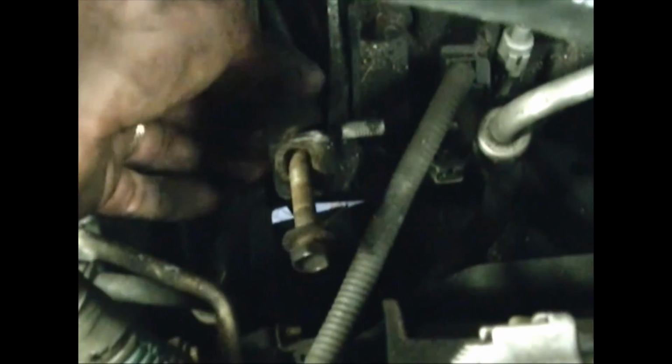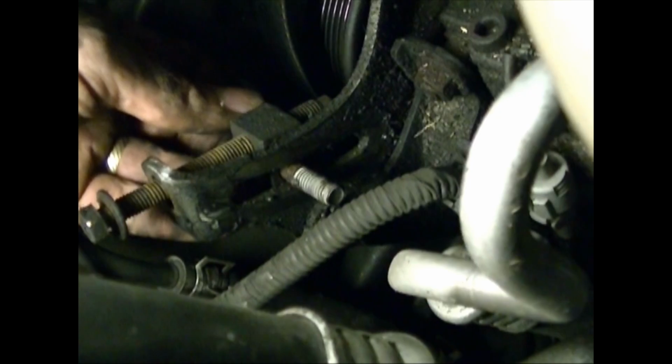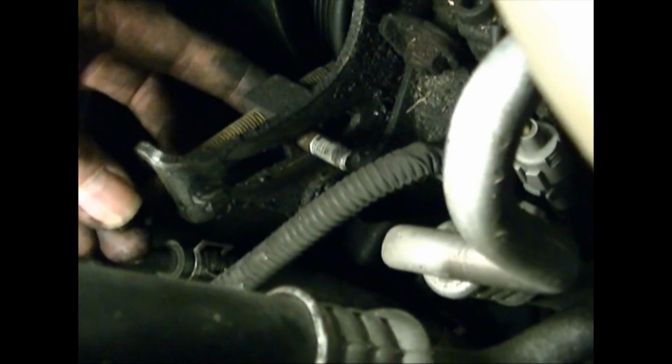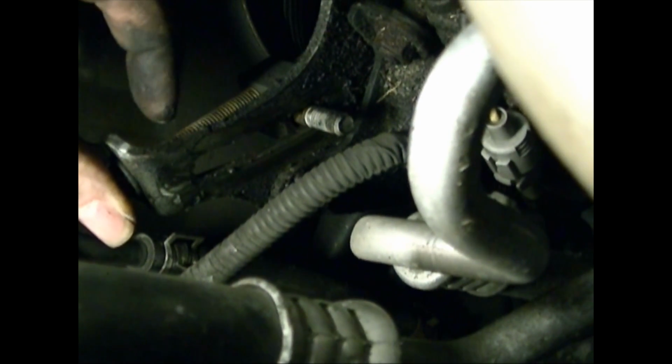This is the tensioning bolt assembly. There's a little block that holds the bolt that's going to screw into the alternator. See this channel along this bracket here. So your screw is going to go through there and into the base of your alternator, which is threaded. So this will just thread right into your alternator. Once you get the screw started, then you can use the tensioning bolt here to tension the belt. As you tighten it, it pulls from this plate, it pulls this block up and pulls the whole alternator tight.